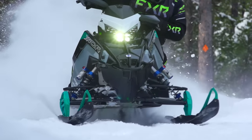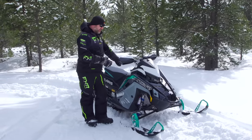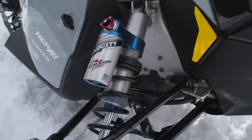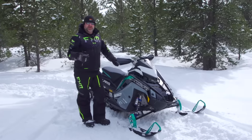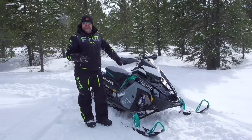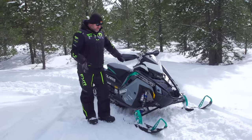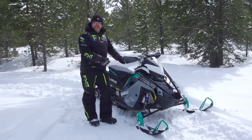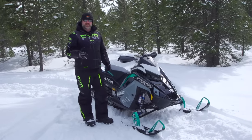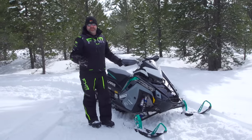With that said, let's look at what this XCR is all about. Up front you've got Polaris's Race IFS, and that is the secret to how great this sled handles. The front-end shocks are Walker Evans Velocity Needle shocks — they're called high-low, meaning they have high and low speed compression adjustability. They are great shocks. I don't know why Walker gets a bad rap in the industry; we've never had a single problem with any of our Walker Evans shocks. I will say that on an XCR it would have been beneficial to have rebound damping adjustability — these ones don't — but that's a small point and most people don't know how to use rebound anyway.